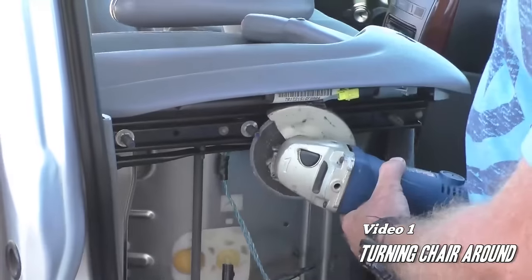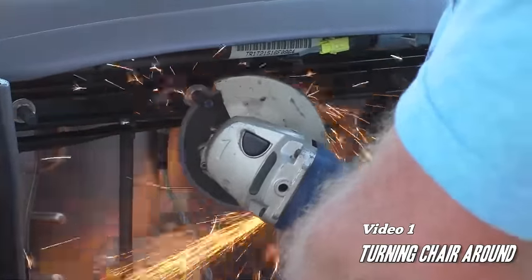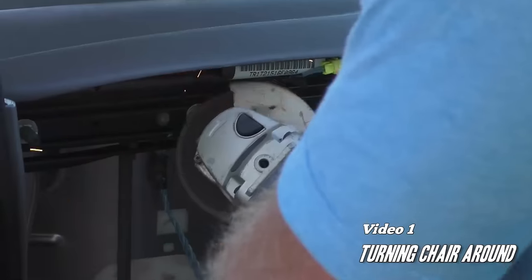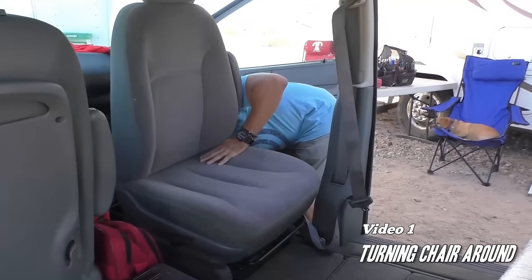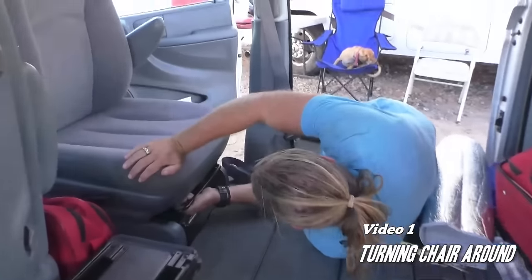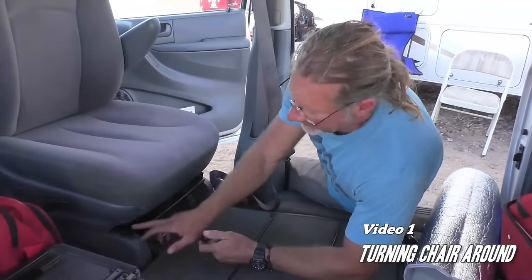Get the guard where we want it. We want to be careful where the sparks are going — if the sparks are flying at our dash, it'll melt a part of that dashboard. This gets really hot, so just be careful. And when the piece falls to the ground, don't pick it up — it's going to be really hot. The main thing is that our tracks are even, because when you take the seat off the tracks, one could be forward and one back, which will limit how far it slides. We just want to make sure the slides are in the same position.